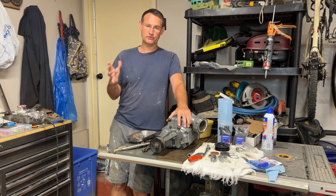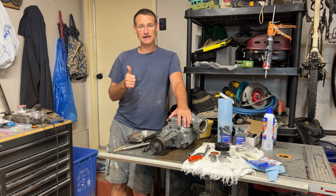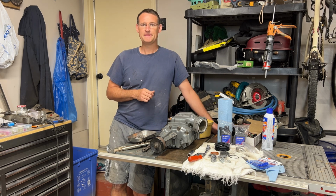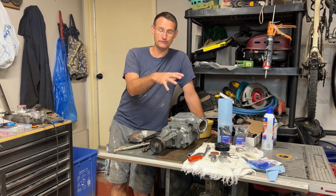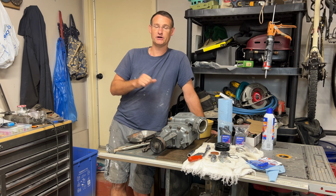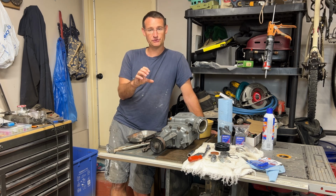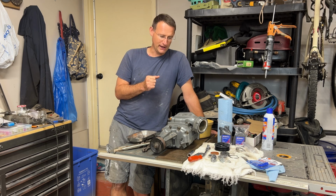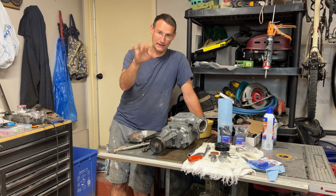Now it would be the same process whether you got a Mustang, maybe a few little tweaks, but a Mustang, an Explorer, anything with a 4-liter SOHC. So first off, what we're doing in this part of the video is we're going to go over the supercharger, kind of what it is, what we need to rebuild in it before we just stick it on the truck. Also our fuel pump, that needs to be upgraded to a higher volume fuel pump, and that's going to be in this video. And then a few little tiny things like the spark plugs, we want to go with a smaller gap, but we'll get into that.